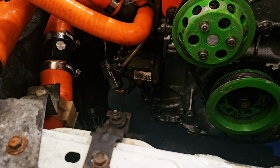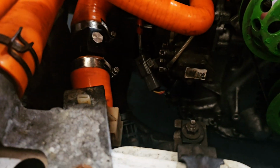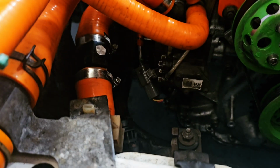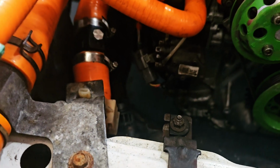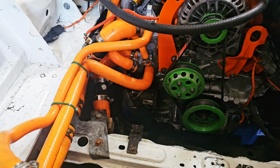Okay, that's the oil metering pump swapped out. I also swapped out the sensor on the end, and went as far as to actually swap out the plugs and extend them on the loom. So everything now has come off the old engine, so I know it runs fine. So that should be the oil metering problem solved.